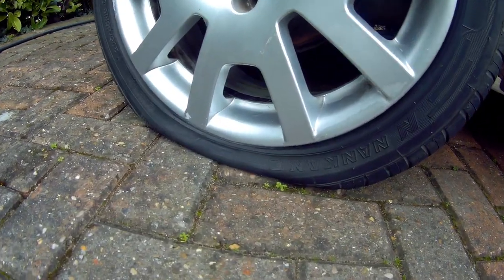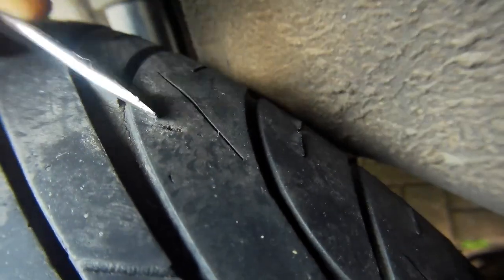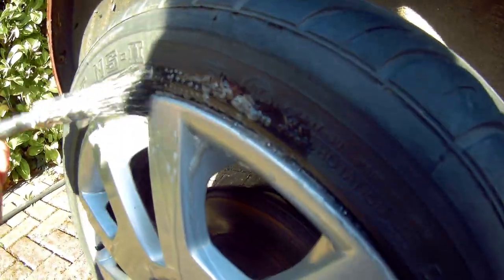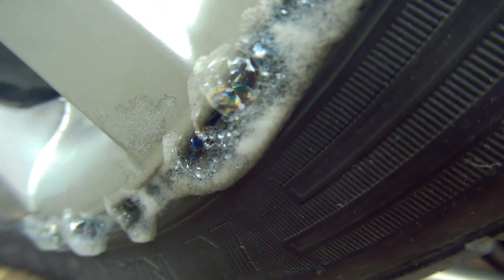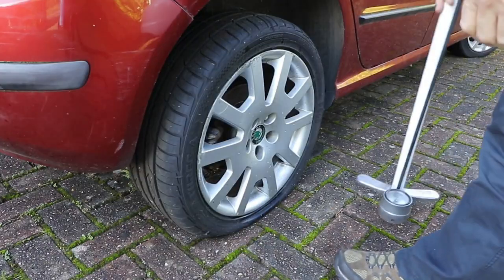In a previous video I kept showing you this tyre that kept going flat and possible causes for it. I looked over the whole surface of the tyre, found one or two stone shards that I removed, and then got some soapy water with some washing up liquid in it, and put that around the wheel and tyre rim, the valve, and anywhere that I thought had a puncture. It seems to be seeping out of the join between the wheel rim and the tyre, which is a common thing. When you get new tyres put on they usually put some seal around this, but when this seal breaks your tyre keeps going flat.